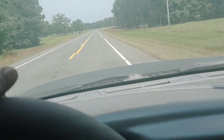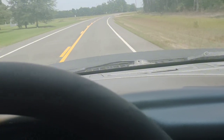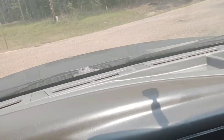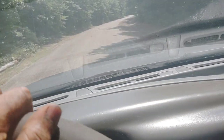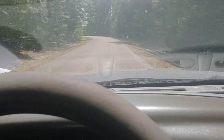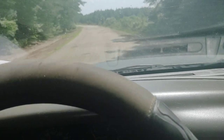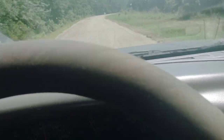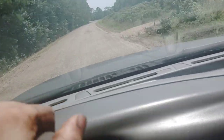It seems like the problem is solved. The mirror is vibrating a little bit, but I also have a bunch of dirt in my tires which can cause that. I'll give an update later — another video down the road if it gets worse or better. But it feels like the problem is pretty much resolved just by shimming where those straps go over the u-joint caps. As always, thanks for watching — more updates coming soon, later gators!